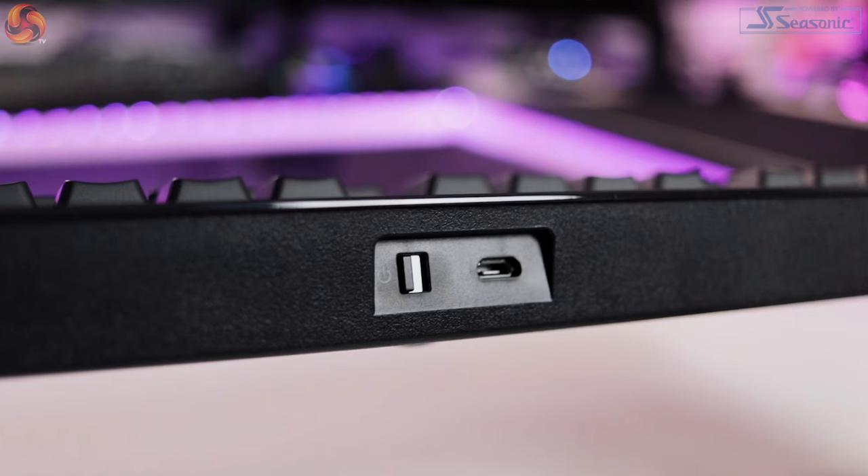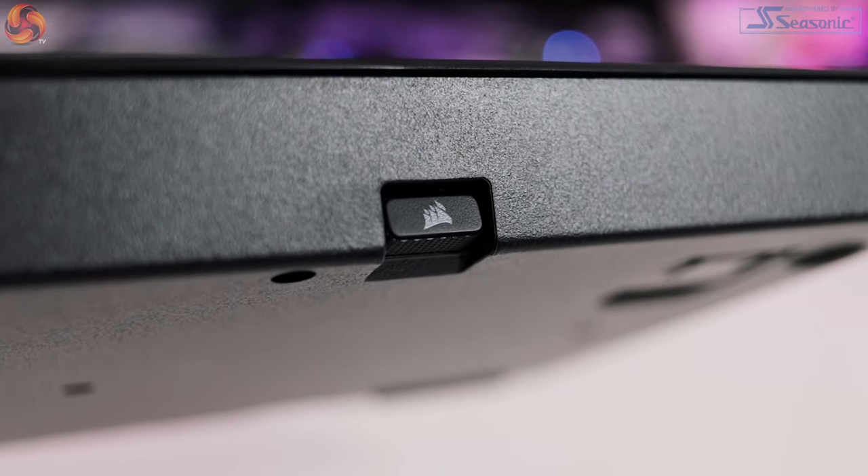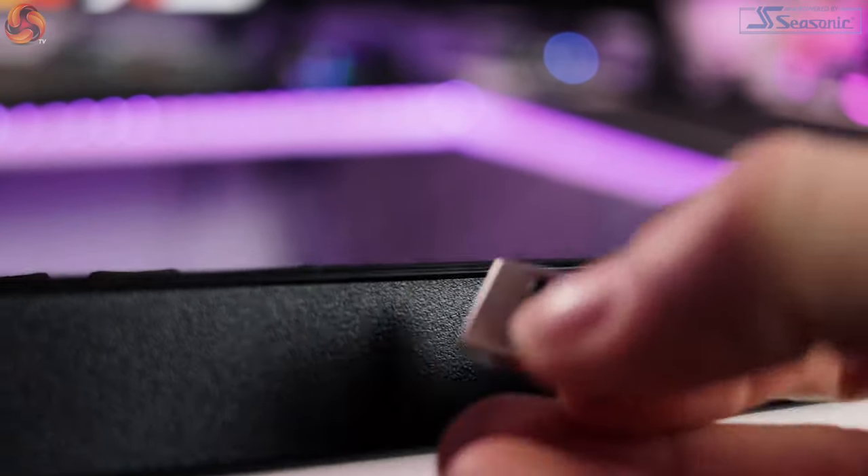On the back edge you've got a couple of little extras that you wouldn't find on a normal keyboard. You've got an on/off switch because it's a wireless keyboard, but you also have a USB port so you can plug in a cable as well, and there's a little hidden USB dongle for the wireless. There's no USB pass-through on the sides, which is expected since this is mainly aimed at being a wireless keyboard — including it would mean more latency or reduced battery life, so I think it's a good idea that they've taken that out.